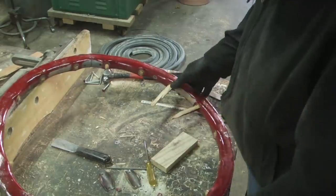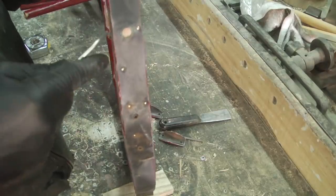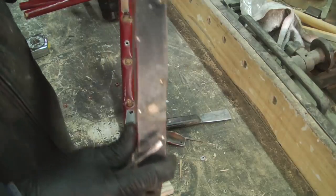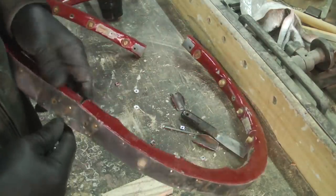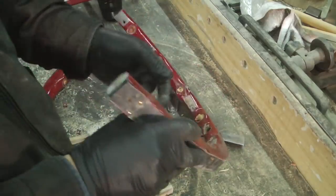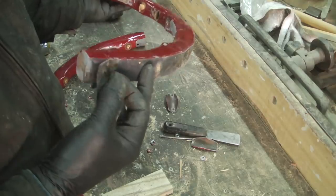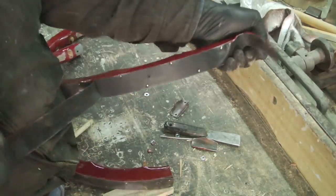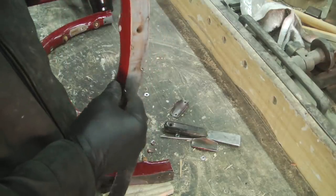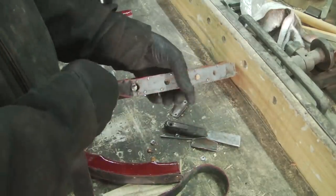But then I found something else kind of interesting. Two layers of inner tube rubber wrapped around the outside circumference. So evidently the wheels had become loose, and you can't size down a clinch rim. So they had tried to build up the wheel. But it still wasn't enough, and so the wheel was loose. And that's why it collapsed.